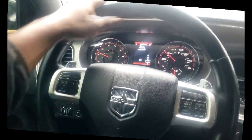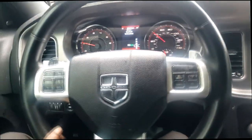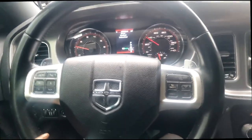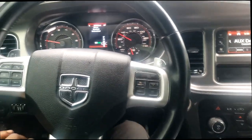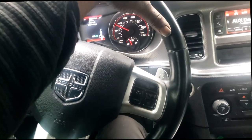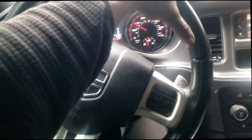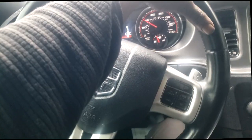Alrighty, guys. I'm in the middle... actually, I'm ending my test drive. Guys, I am convinced the problem with this car was air pockets. Yes, it was not bled properly. Like I said earlier, there is a bleeding procedure you have to do on this car, but you need to take it a step farther. The simple bleeder screw on the thermostat is not sufficient, in my opinion.